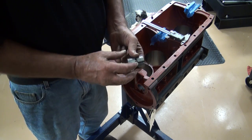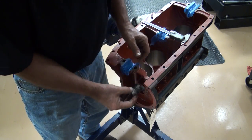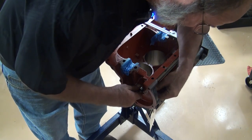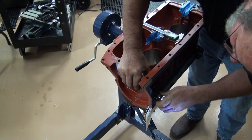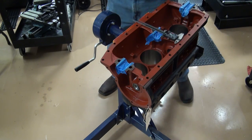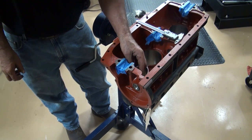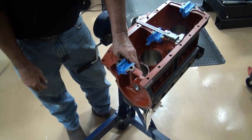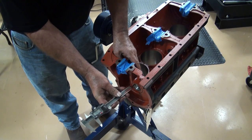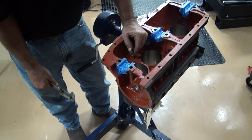So you've got your cam bearing — which end are you going to take it off? I've had it where I've taken it off the back side and not even touched the front side, and I've had it different ways. So I just go ahead and slide it in where it goes and use the little cam bearing block. I've got my cam bearing stuck in there, and the cam bearing is actually flush with the back of the block on this one. So I'm going to remove the material off the front surface — we need to remove about 30-thousandths, and it's sticking out the front some 64-thousandths.